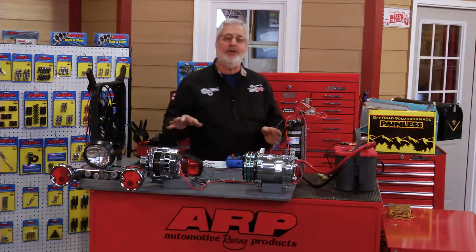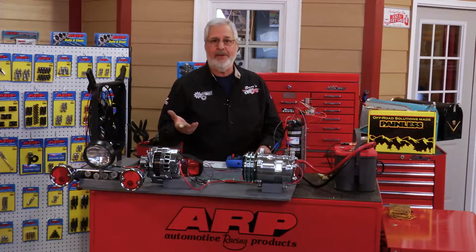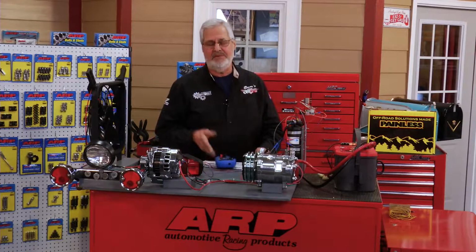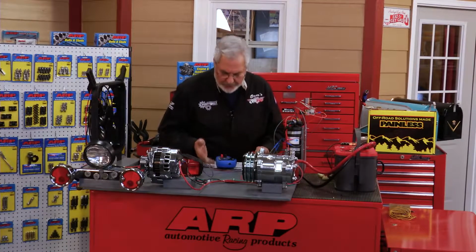Stop with the test lights. You can get yourself in trouble with a test light. And when you look at a test light that's glowing, the bulb lights up. How many volts are there? A good voltmeter is good to have. And I'll tell you what, you can buy a good voltmeter for 50, 60 bucks today. And you can buy a more expensive one. This happens to be a good multimeter, but I'm on a 40 volt scale.